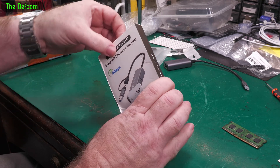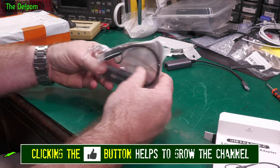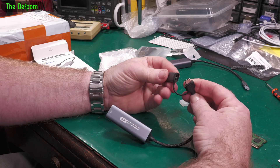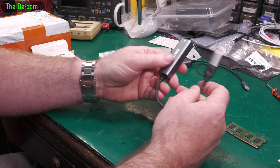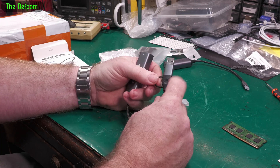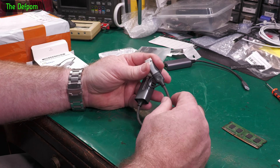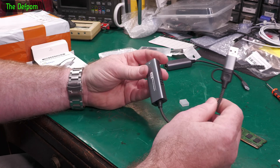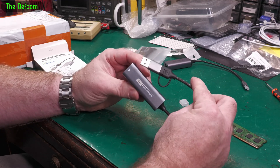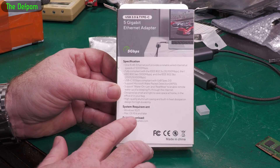Another network adapter. This one is supposed to be 5 gig, but the price seems a bit cheap so I'm not actually sure. It's got USB-A and USB-C as well, so there's a little built-in flexibility which is useful. Obviously if you're using USB-A you might be restricted speed-wise. For USB-C you really need a 10 gig port — otherwise you'll be bottlenecked by USB overhead and might only get around 3.5 gig on a 5 gig port. As long as you've got a 10 gig port it should in theory do 5 gig speed. I'll have to try it out. Drivers download from Realtek apparently.